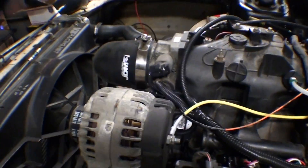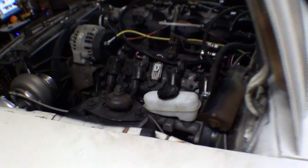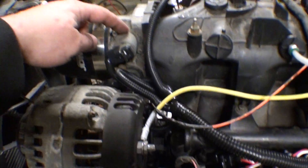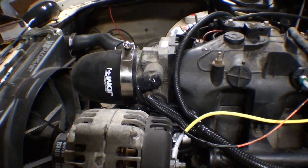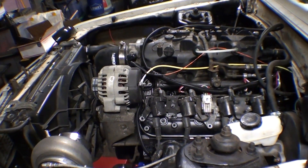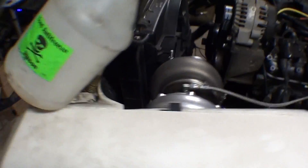The other throttle body — this is the second throttle body I had on the car. The first one is over there somewhere. I was bottoming out the stepper motor at like 5 steps, and then with the other throttle body on it would bottom out and still hang at like 900 RPM. I don't know if that throttle body has a leak somewhere — around the idle air control valve, TPS, or throttle body seal. The idle air motor is moving but it idles high. That would be a perfect candidate to investigate and use for a micro squirt setup where you want it to idle around 900 with a raunchy cam and a TH400.